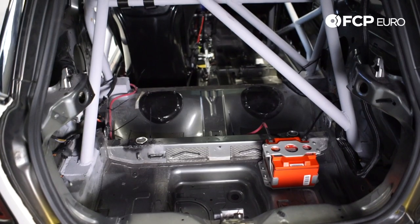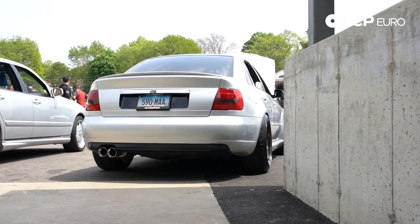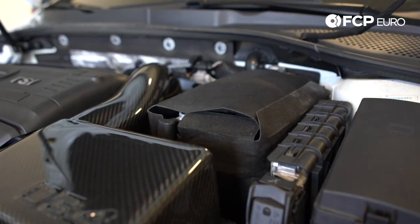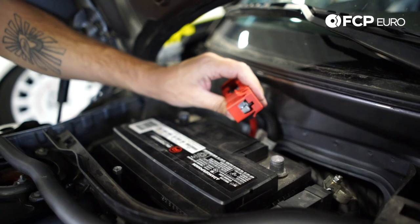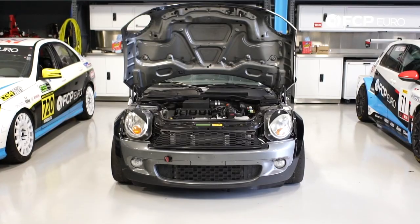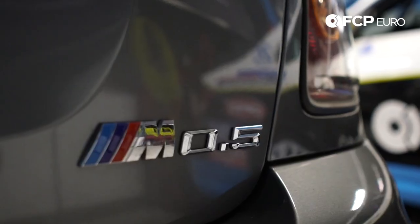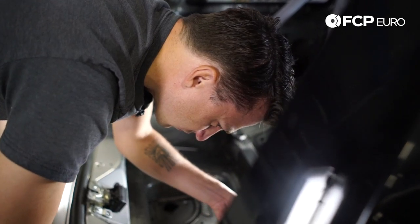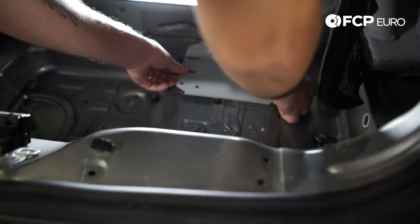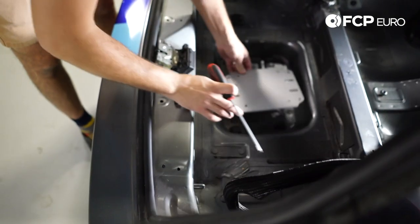The first thing you want to consider when relocating your battery is where you're actually going to locate that battery. This may differ if it's a race car versus a show car. Oftentimes with show cars, we're just trying to move the battery out of the engine bay to make it look clean and nice. On a race car, we're more considering the weight of where the battery is going to go and trying to corner balance the car and make it go as fast as possible on track. This portion of the project is purely preference — the battery can be located anywhere you see fit. It is important to make sure this is the final location and you're only drilling and cutting interior bits once. Right here I was planning on putting the battery at the lowest portion.